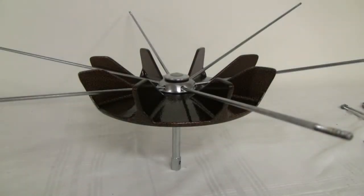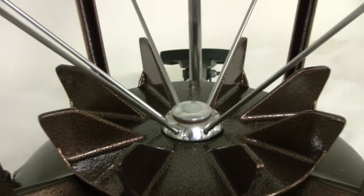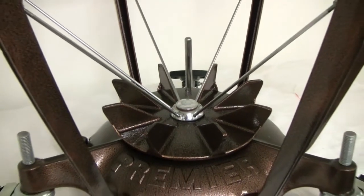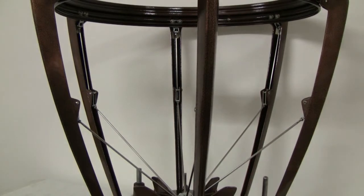The fine tuning wheel has been assembled with the straightened and polished spider arms or spokes. From this angle you can clearly see the new pull rod. The fine tuning wheel is installed, and the spider arms have been screwed into their corresponding linkages and locked in place. This is a great feature that allows all of the arms to pull evenly for tuning adjustment across the range of the drum.